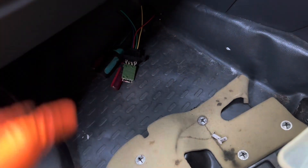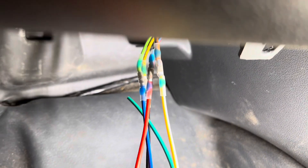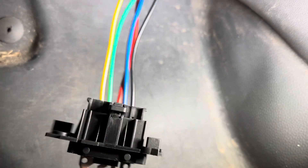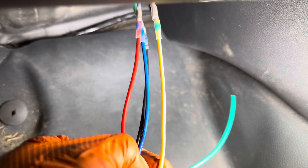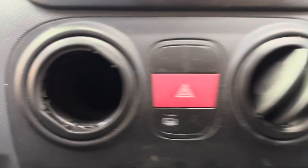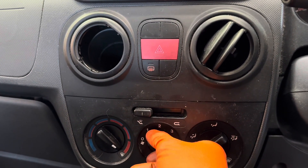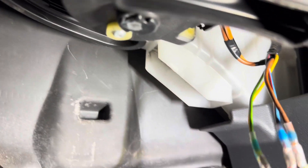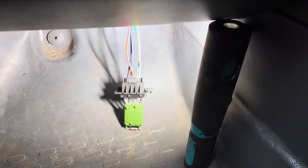So we're going to start chopping — I'll chop the loom and come back when it's in one piece. Right, so we're all soldered together now. Obviously we've matched up the wires, making sure they're the same colours as the one that came off. We've got one redundant wire which is irrelevant. Now we have one working, two, three, and four. So now I need to put this back in its hole up in there, push it in, slide it across, and we're good to go. So if your blower is only working on number four, this will be your problem — that's how the change is done.